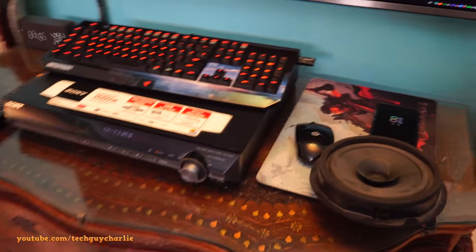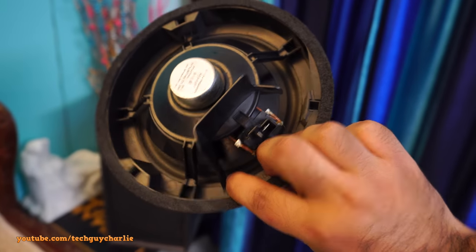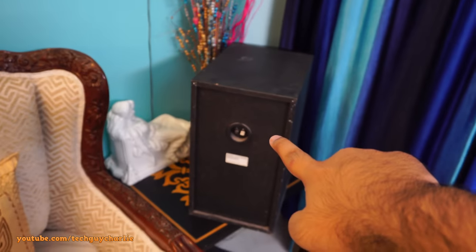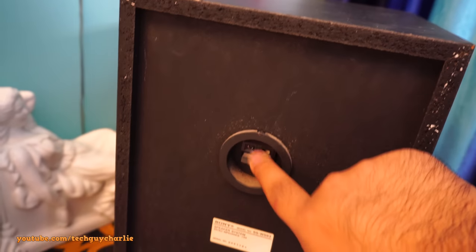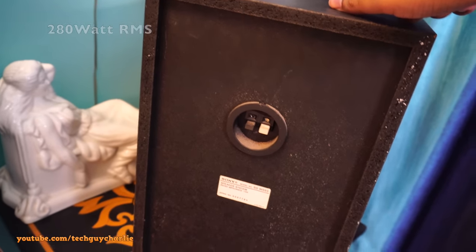I did a little audio test off camera using this old speaker. I connected the speaker to the wire which goes into the subwoofer — it was very difficult to do on camera. But the amplifier is completely fine; it is outputting audio signals to that cable, so the problem lies in there. I checked the connectors again and they appear fine, so the problem is definitely the wire which connects to the inside of the subwoofer.